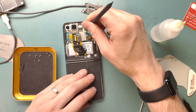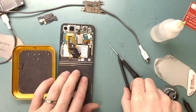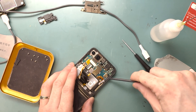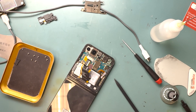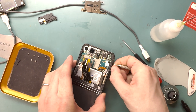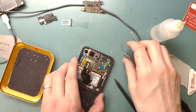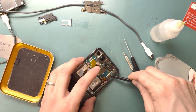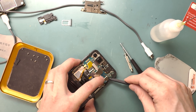If you want to watch the full-length version, you'll have to join my channel for its perks. To get out the main board, you're going to need to remove the SIM card tray first. I can't believe I forgot to take it out — this phone doesn't even run on a SIM card, and it's still got a SIM card tray. We'll grab the pointy end of a plastic spudger and poke right where the SIM card tray comes out on the side, then lift up the main board. The main board stores all the data, so be very careful with it.